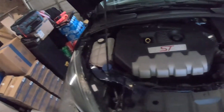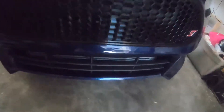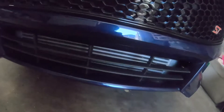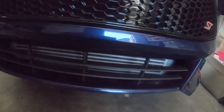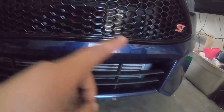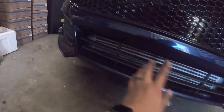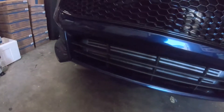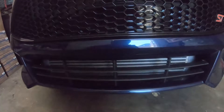I also ordered the Mishimoto charge pipes for the intercooler, but those are on backorder eight to ten weeks — I'm going to wait on that. It's not 100% needed right now, but I can tell I probably have a small leak somewhere, especially on the hot side. I was never happy with how that was clamped, so I'm going to change that and hopefully resolve whatever issues I have. Usually I only pull about 19 psi on this car.